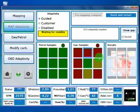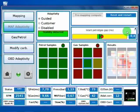If you have a condition where the gas samples map remains all green squares, it means that every region of the result map has been optimized for injection time, so practically you have the same injection time on petrol as on gas, but it's quite impossible to have a condition like this one. To check the difference in milliseconds that you have running on gas or on petrol about injection timing, you can click here on show gap, and you will see in every single point how far you are from the optimal mixture.